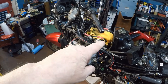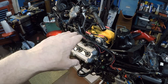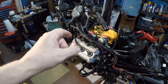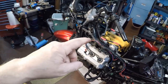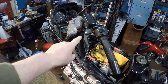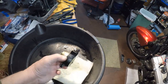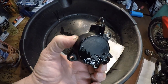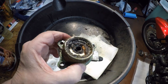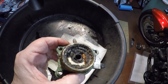I have the carbs off and they're just sitting in there - I put a rag over them. I want to clean all my connectors that go together. This is the master cylinder for the clutch, and there's a slave cylinder down there in front of the bike. I got it off, and here's why I clean and work like I do on a used bike - you can see the inside is so cruddy and nasty.